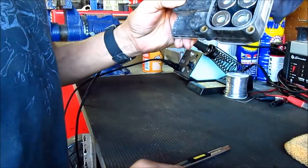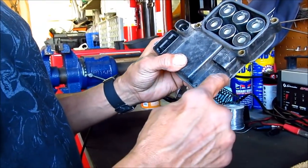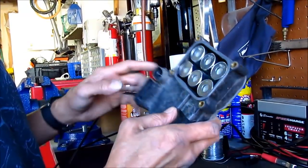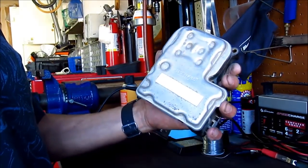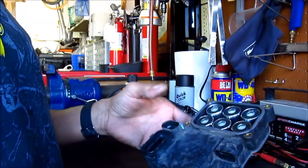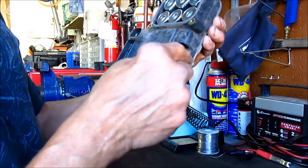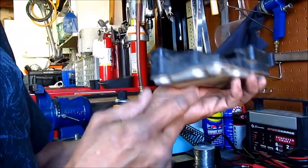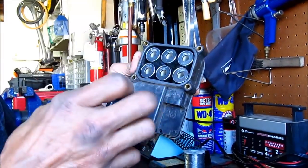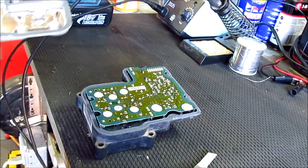Got the module out of the truck — it was easy to take out. This is what she looks like. Now on YouTube, on these Kelsey Hayes modules, there are supposed to be screws here, here, here, and two on the inside. But this one doesn't have any screws — it's actually just RTV'd together, glued on the top cap. So I'm gonna take my chances and open it up. What I may end up doing is drilling holes and tapping them into the top cover in order to hold the silicone RTV gasket together while it dries. For now I'm gonna go ahead and start cutting this open.